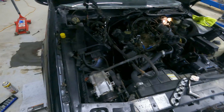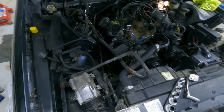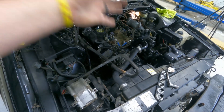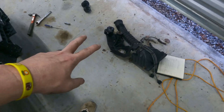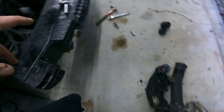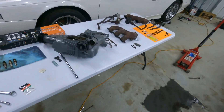One of those items being the EGR system. You can see how far I had to tear the motor down. EGR only involves taking down the passenger side, which is the easier of the two sides. Honestly, the supercharger could still be on there — I only took that off because of other projects I'm simultaneously doing, like the fuel lines. You can leave that all where it is. All you really have to do is take off the front bracket with the jackshaft stuff, the air box, plug wires if you want, and then you have access to the manifold bolts.